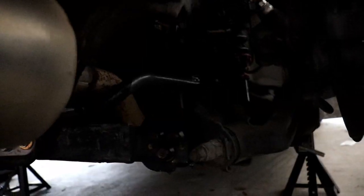So it should be a fairly simple job — you're just swapping out some parts. Those right there are the bolts I was talking about. It's kind of dark under this car, but there's three on this side and three on the other side. Hard Race does throw in new bolts to replace those with just normal six-point bolts. You'll have to reuse the bolt that goes to the subframe. The specific bolts came with progress since they're a little longer. It's a simple swap: just unbolt, take off four bolts on each side, swap the part, and bolt them back in.